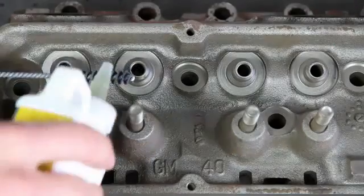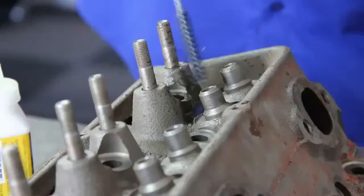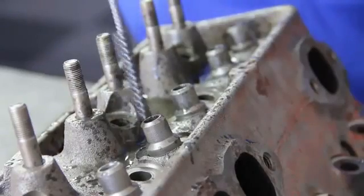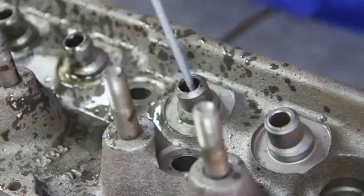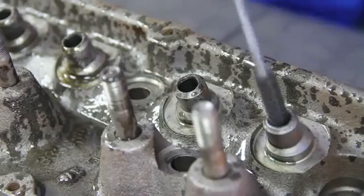We're using their 8mm BC series at 800-1000 RPM, 6-8 strokes per valve guide with a total honing time of 15-20 seconds per valve guide. You want to use a variable speed drill or a drill press, and be sure to check out your owner's manual to determine the speed range and adjust accordingly.